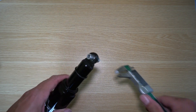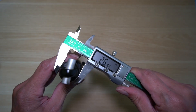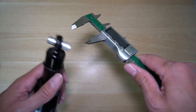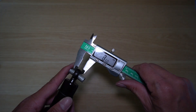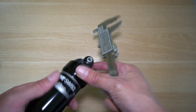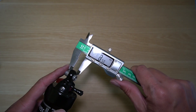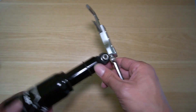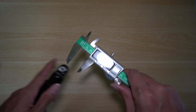Just to get some more measurements, I'm going to measure the width of the barrel of the suspension here — that's about 27 millimeters across. Measuring another portion just to be sure — yep, 27 there. The top part here is about 8.5 to 8.6 millimeters, and on the top side I'm assuming it's going to be around 8.5 to 8.6 as well — about 8.5. The measurement here is 21 millimeters, and probably the same with the other side — yep, about 21 millimeters there.